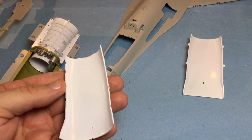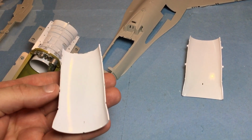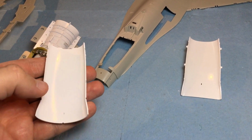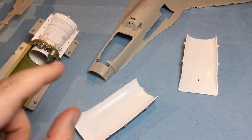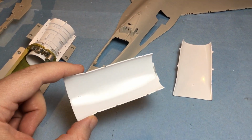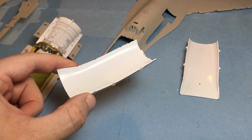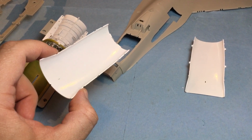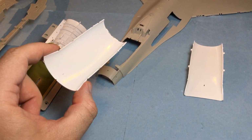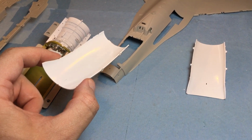And the hardest part with the intakes, obviously, is to make sure you get no dust or debris or that white goop that sometimes happens when you're spraying white, right? Sometimes it wants to drip or something. So you're talking a good 3 or 4 coats of the whites. Prime it in white first, and then just take your time with it. And then you get that nice sheen.